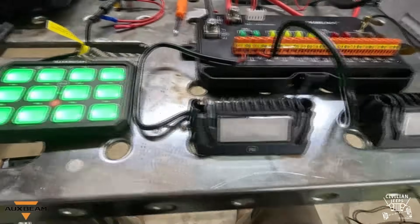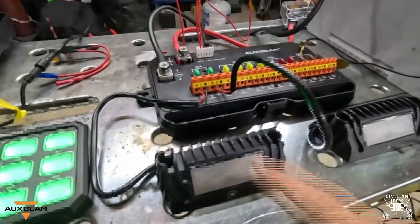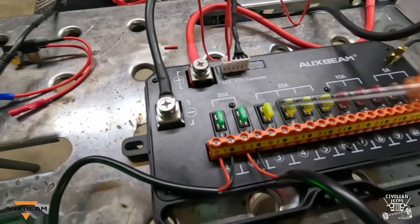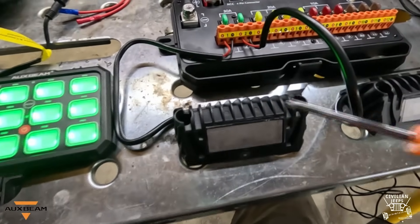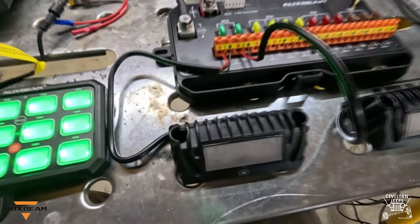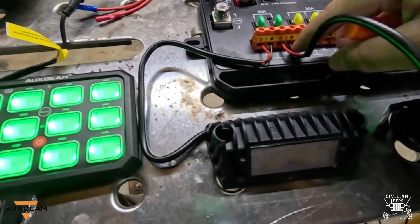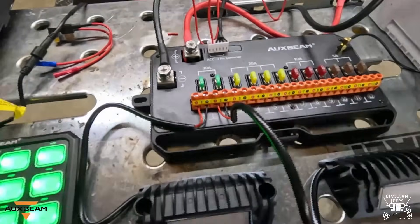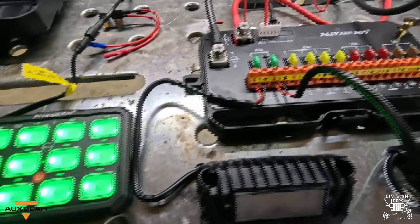When you want to add an accessory to it — I've got these little LED lights that are going to be going on the tent trailer over there. So this is going to be like a floodlight for me. They don't need a 30-amp relay, but I put them on a 30-amp relay just for the sake of this video, being one and two on my toggle panel. You want to look and see what your actual device is rated for as far as amperage. If I wanted both of these to turn on together, I would just put both the positive and negative on one relay and it could easily handle that, but for this video I decided to put them as one and two separately.